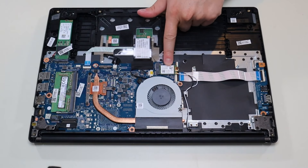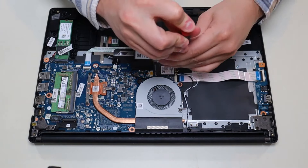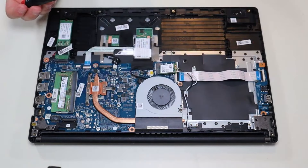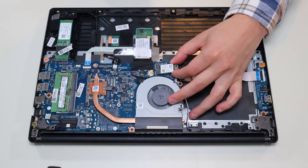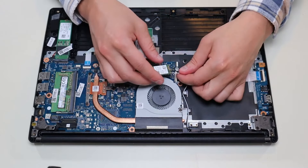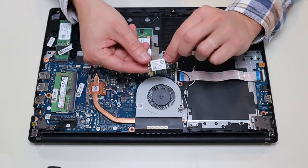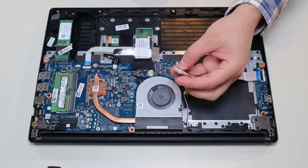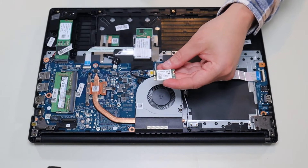Your Wi-Fi card is right there, held down by a single screw on the side. Undo that screw — it was in there really good, so try not to strip it — and that releases the Wi-Fi card so it can pull out of the port. You also have antenna wires here, which just snap right off of the Wi-Fi card. I'll have the Wi-Fi specs, info, and a replacement Wi-Fi card option in the link below in the description.